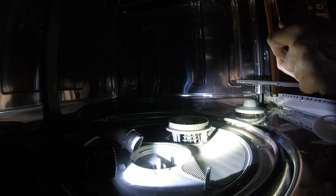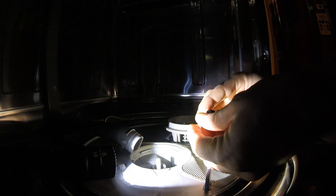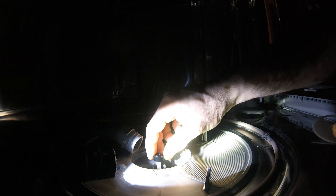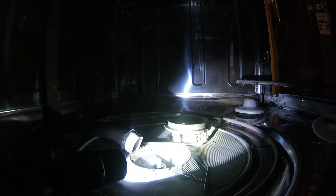Now we want to take a little bit of silicon grease, smear it all around the oil seal, and pop it right in around the shaft again. We're going to coat this with silicon inside and out on the side wall to make it easy to insert. Then we're going to simply insert that onto the shaft — I may have to push it in a little bit — there you go. Now we're going to have to push with some force and jam it in there, using the end of a spoon to push it all the way in.